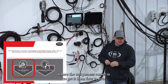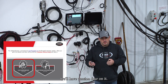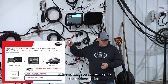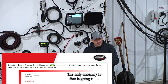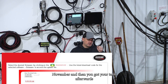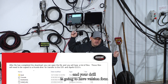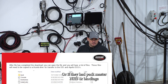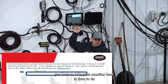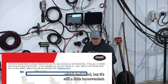Here's where the uniqueness comes in going from 4 to 5: anything you received prior to November will have version 4 on it, and anything from November on will have a prototype version of 5 so updates are easier. The only anomaly is if you got your drill before November and your tank afterwards — then your tank will be at version 5 and your drill will have version 4 with Packmaster, NH3, or blockage. In that case, you have to take your monitor back to version 4 to update the ECUs on the drill, then bump it back to 5.